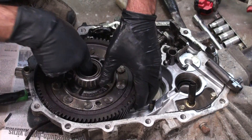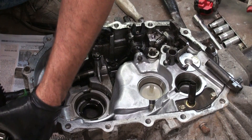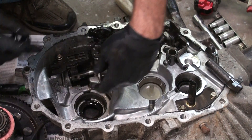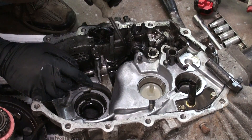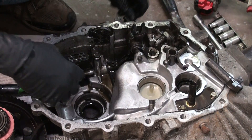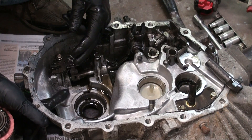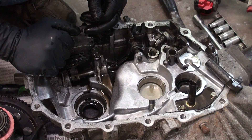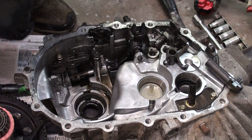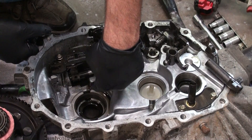Let's see what we've got. There's a little bit of scratching up in there. Looks like the shift right here has got a little piece — looks like a little spring came out over here. Pretty much it grenaded in here, and it put a big fat crack right through here. So that's what happens when things come apart like that. This one had actually gotten some other damage from an accident, and so it did the damage to the housing. I was tearing it apart to see the full extent of it, and once it came apart like that, it did some damage.